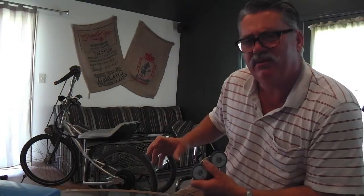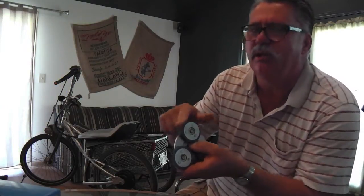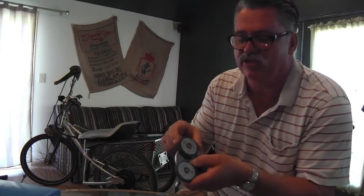Tilt it down just a hair. Yeah, there's the hub motor right in the rear, and this came out of there, and after two years it came out of there because I was getting slippage when I'd hit the throttle and maybe go up a driveway. I'd start hearing slippage, and so I thought, it must be these composite gears. They're plastic. They probably wore down, and it's been 2 years. Maybe it's time for me to change those out.